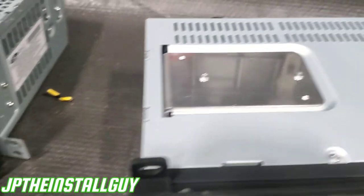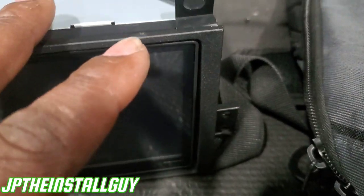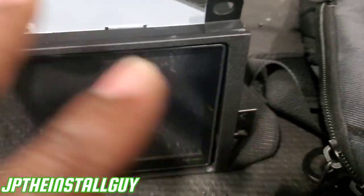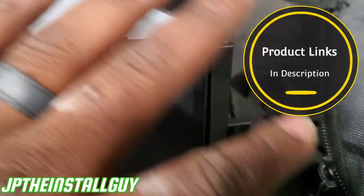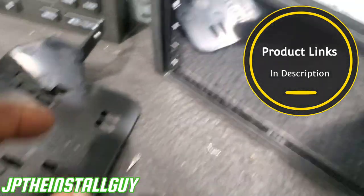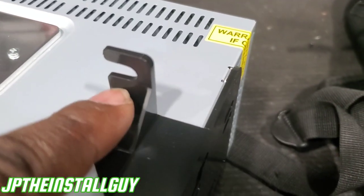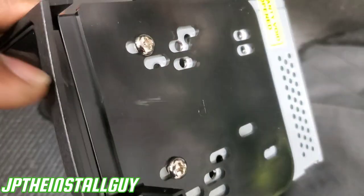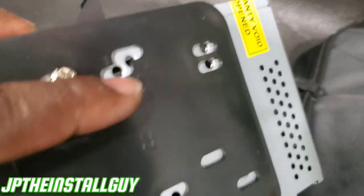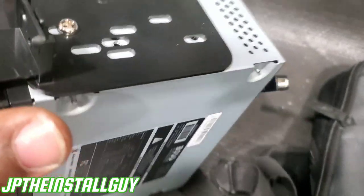We are here at the test bench. We have our aftermarket radio with the dash kit. The dash kit comes in three pieces — I just want to halfway put it on so you can see what it looks like versus what we're going to do. We'll have all the descriptions and parts listed in the description. You're going to have a trim piece and two side pieces. The radio has two parts at the top, so make sure this part is at the top when you put it on the side. I like to slide the dash kit front piece on first, then slide this up to where the two parts meet, which helps you line up the holes for the screws that came with the radio.